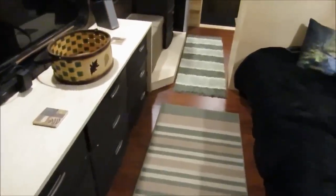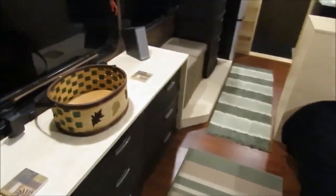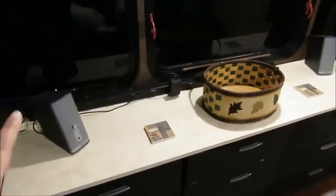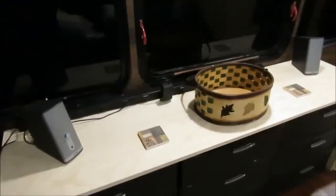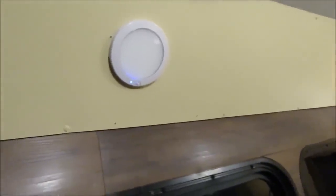Here's some of the prettiness — these are our cabinets. We have three doors for me, three for Randy, and then one for blankets, sweaters, and towels, whatever the season is. We just wrapped a wooden shelf across the top and down the two sides so we can put heavy things up there without breaking the cheap plastic cabinets. And here are the new lights we put in — three on either side, they're LED, 12 volt, and they work with the battery system in the back of the bus, so they run whether we're on shore power or not.